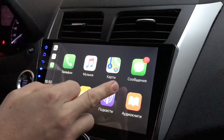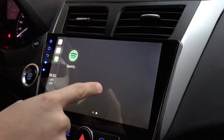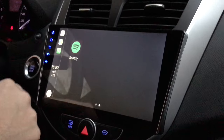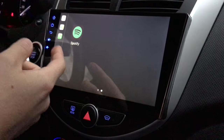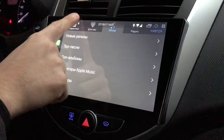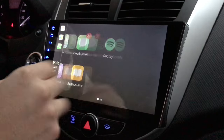At the time of recording, if you have Spotify installed on your head unit it still has that problem where both instances get affected. To get around that problem, what I did was create a Tasker profile which automatically disables the Spotify APK on the head unit as soon as you open Z-Box, so they don't conflict with each other and you can properly use your steering wheel keys. Right now in Apple Music it works fine — I have my play/pause working. As long as my Tasker profile disables Spotify by default, it doesn't conflict.